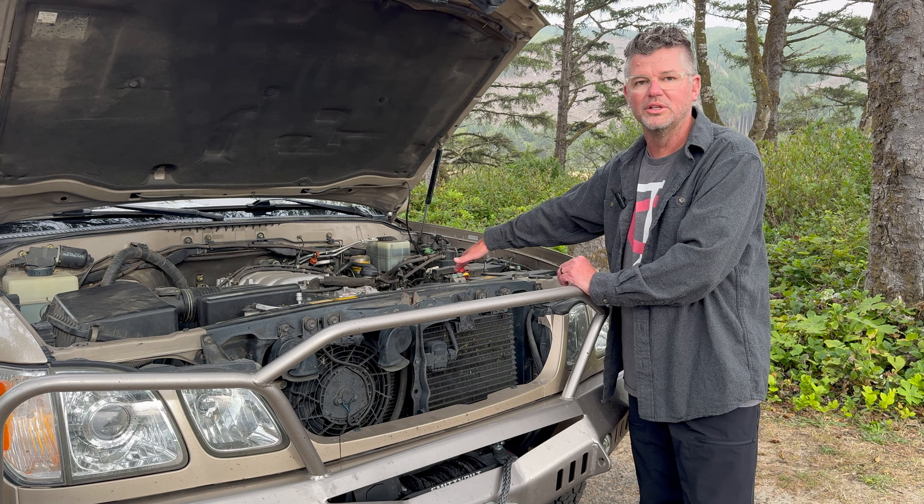While we're up here, you can see that the factory turn signals were in that bumper. So when this custom bumper went on, those became just marker lights. There's a little piece called a turn signal eliminator that takes the two wires and combines them, so it'll flash your marker lights on and off to use as turn signals. For the factory wiring that used to run to the lights in the factory running boards, I repurposed that and put some LED strips along the frame. When you open the door, you can see the LED lights come on down here, and then the factory timer after 15 or 20 seconds, they'll just shut off.